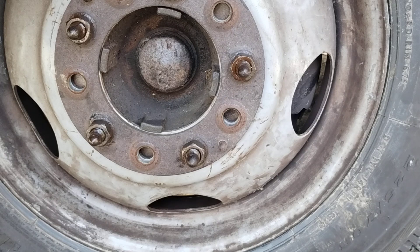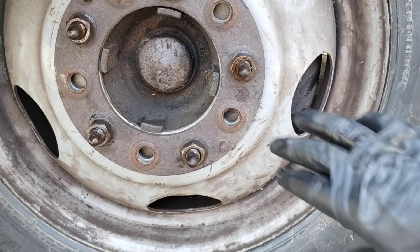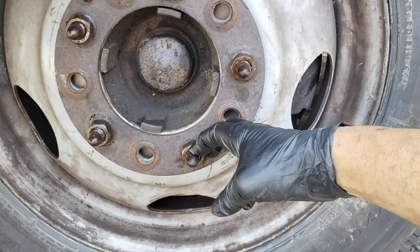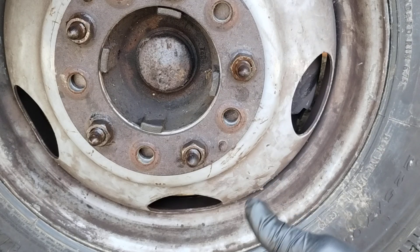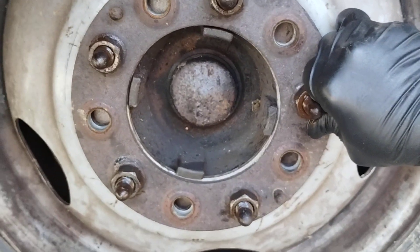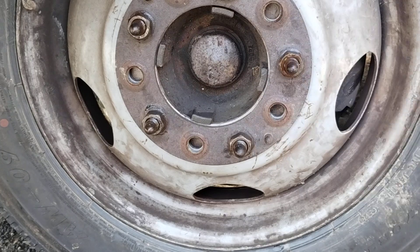Hopefully this was helpful for you. I do clean the plates up with a wire brush — see how nice and smooth that is in the back. That's because I use a wire brush specifically, not a grinder or sander — you might grind away some uneven spots. And you don't have to go back in a few miles and check this, as you may if you go to the dealer. This is clamped. If you want to make sure, you can mark it with a yellow marker or count the threads back. But remember, if you're going to check the torque, you've got to check it off the ground. That's my position, 100%.